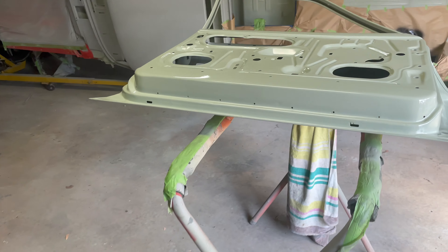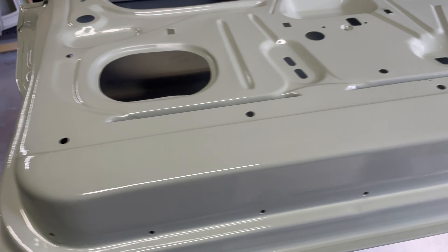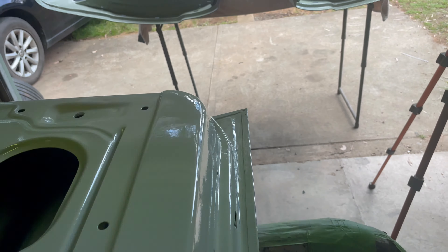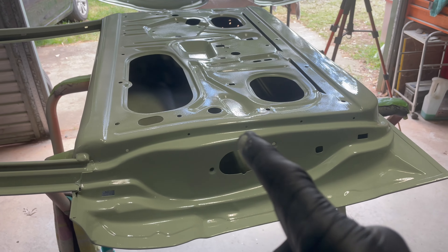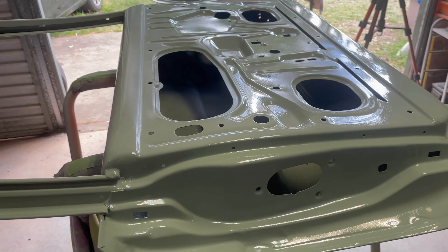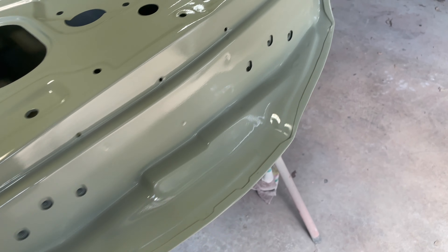This door is complete. Got all those little tiny dents out of there — weren't much but it's nice to have it perfect. So that's ready for one more gentle sand back and some 2K primer, which is really nice — goes nice and smooth and flat and sands really beautifully. Nice for colour. So that's one door done.